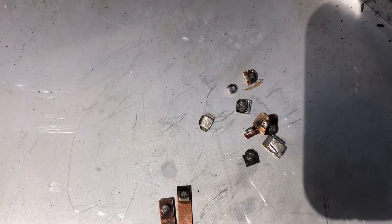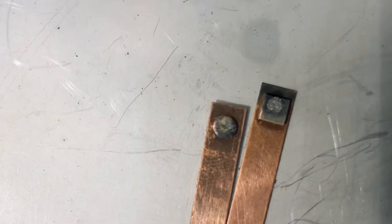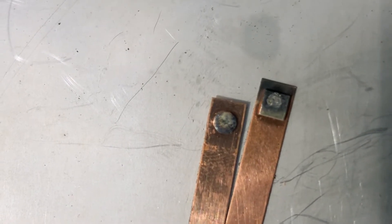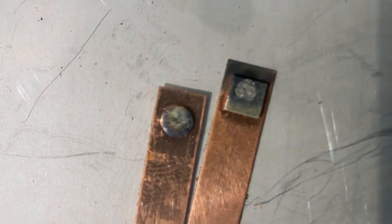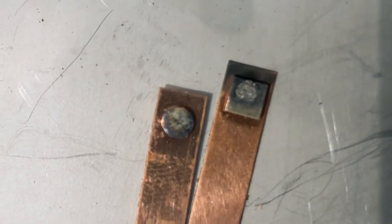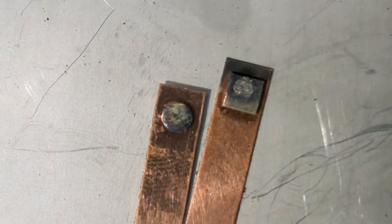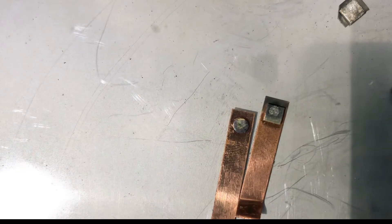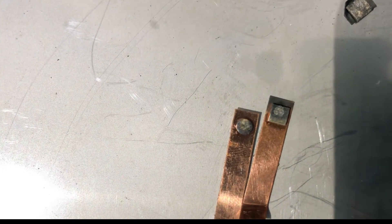You take that apart and there's a little circular thing in there that's got copper. Some of the ends are from the switches. Over here, if you want to go through the trouble of taking that all the way down, there's a little piece on the end — one's round and one's square. Those are contact switches inside the little boxes behind the control panel. That's a little piece of silver. If you want to go through the trouble of taking all of them apart and saving them up, you'll have to smelt them down. But just for recycling purposes, know that there's silver inside washers and dryers.